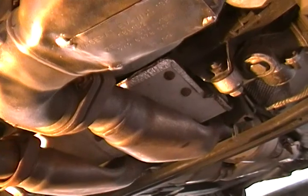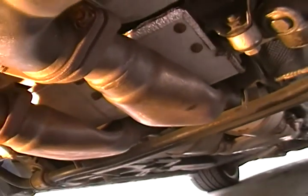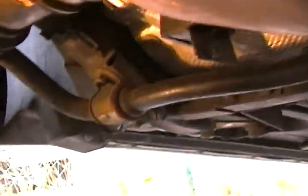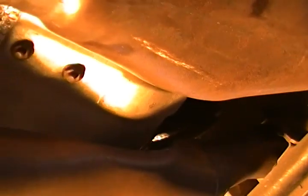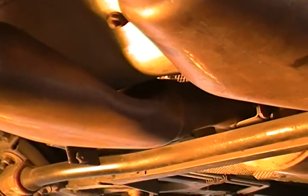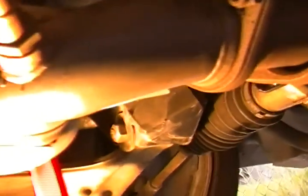I believe, at least that's my opinion, that's the reason why they pancaked these downpipes. I hate it. I know that's very restrictive exhaust flow there. But I'm thinking if you replaced them and opened them back up, eventually you would probably get them pancaked again. Let me show you an example of what I'm talking about. Let me see if I can get this light. If you look on the bottom of these, you can see the scrub marks. So even with these pancaked, they were hit. I'm sorry guys if the camera's all messed up. I don't know if it was from speed bumps or what, but I do know that if they were any fatter in that area, one misstep, not paying attention driving, and they're going to be all banged up just like these cats were.